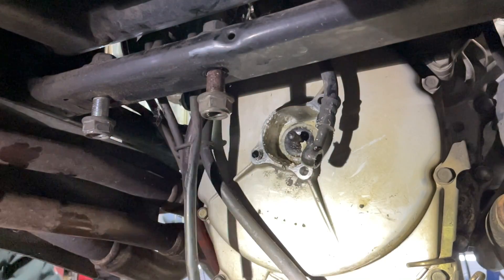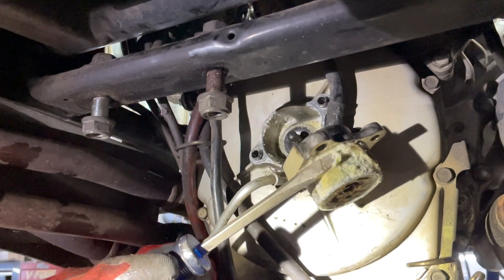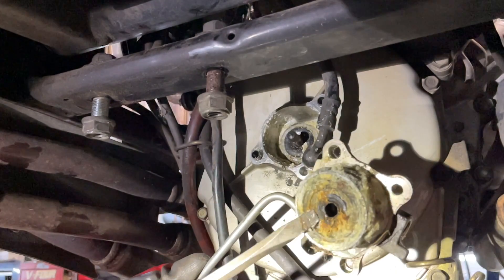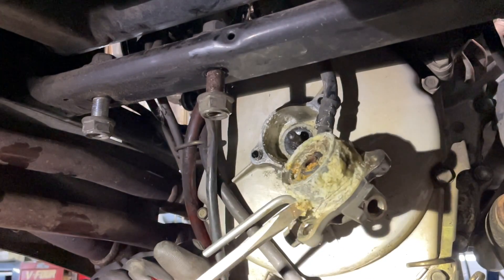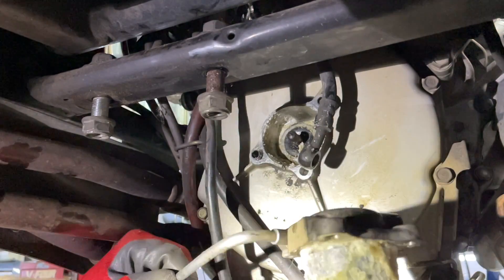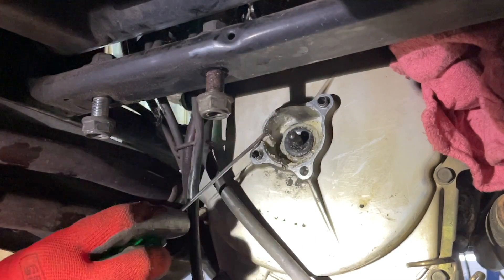I leave the rod installed inside that seal. Look at that thing — it's disgusting. You see this all the time with bikes that sit; no one wants to change the fluid out on them. It crusts up. That's straight-up brake fluid that has dried up, and it locks that piston inside of that slave cylinder. So you've got to get creative on how you clean these things out.